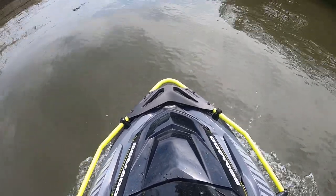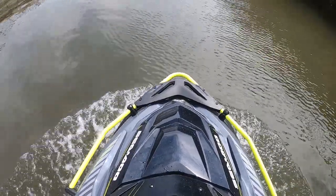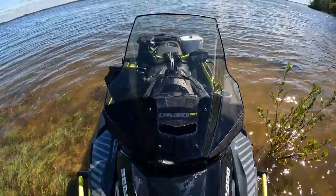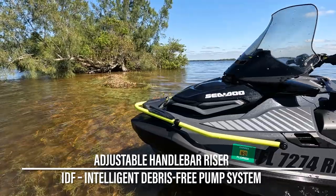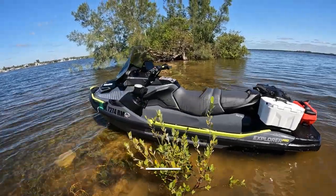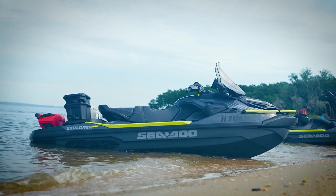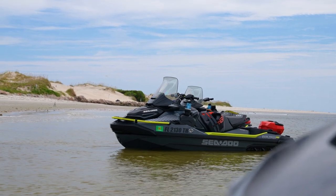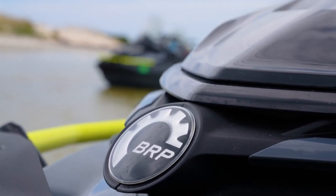The Explorer's ST3 hull is still made from BRP's proprietary CM Tech, which still doesn't respond well to beaching. There's no reinforcement or rubberized keel guard as some had speculated. Although the $16,799 Sea-Doo comes equipped with Sea-Doo's intelligent debris-free pump system — that's IDF — it's mainly intended to purge grass and kelp tangled in the intake, not dislodge small rocks and pebbles from the impeller. It's not too uncommon for rocks to wash up into the pump while beached on a shore. Let me re-emphasize: don't beach your skis! Buy an anchor and tie it up in three feet of water. There's a reason they put that in the owner's manual.